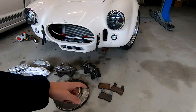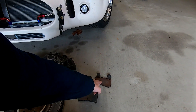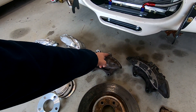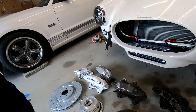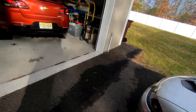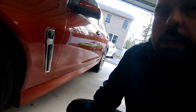I also want to go over different types of pads. You're going to see three different selections: this pad will allow you to run a 19 inch wheel, this pad requires a minimum 20 inch wheel, and this pad you can probably go with about an 18 inch wheel. The reason is these stick out the top of the caliper. That's actually why the Camaro comes from the factory with 20 inch wheels — it's the dampers on the pads. On my GTO I run no dampers and get no squeaking with an 18 inch wheel, but my Chevy SS does have these weights and I get some squeaking when the pads are cold.